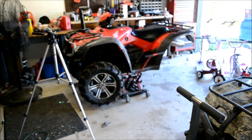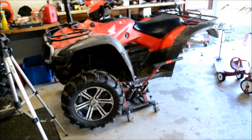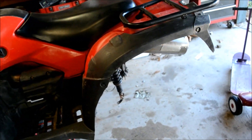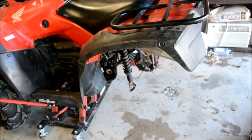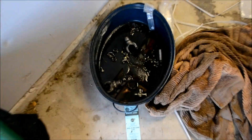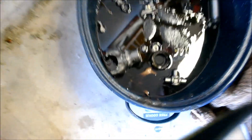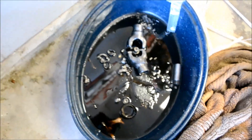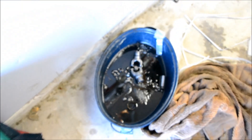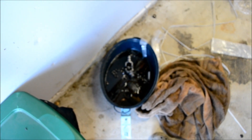I also have a project going on over here — it's a 2009 Honda Foreman 500. The U-joints blew out in it, and I'm going to replace them and make a video on it. The swing arm bushings are toast on it too. The spider actually broke right there, and this comes as all one assembly. When you buy it, it comes with both joints and the spider, plus a shaft, a spring, and some seals. We'll get it all in and see how it turns out.